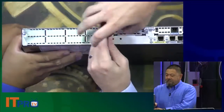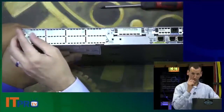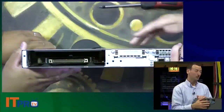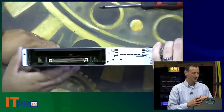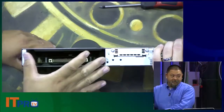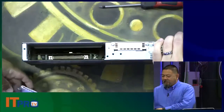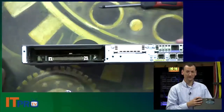In the early days, when 100 megabit networks were just coming out, they made a giant network module that just had one 100 megabit interface on it. But today you can get all sorts of different modules, like ones that add four WICs, or the 16-port switch module — you pop it right in and it's like having a switch built into the router. You can see the main connection back there. It's always important to keep covers on empty bays; leaving them open disrupts airflow inside the unit and can cause it to overheat.